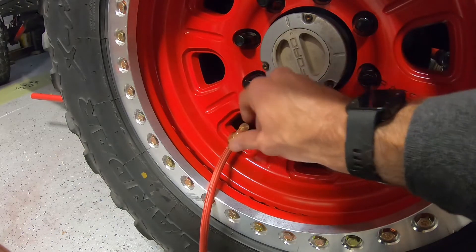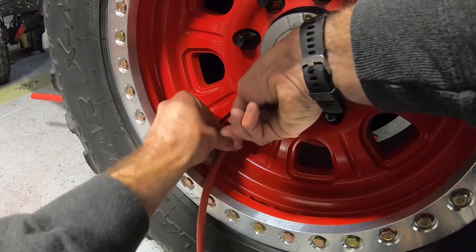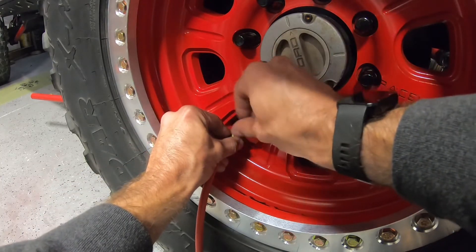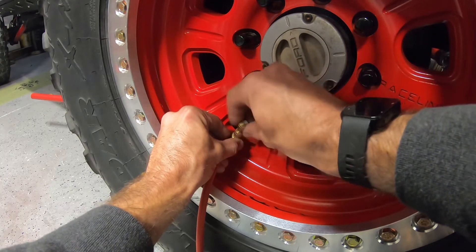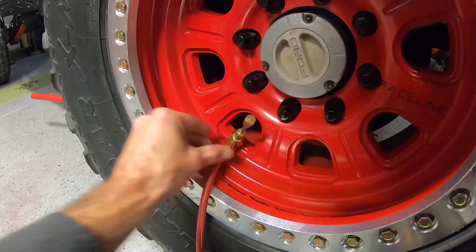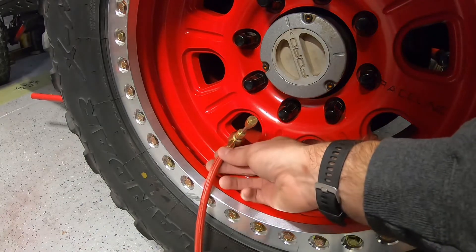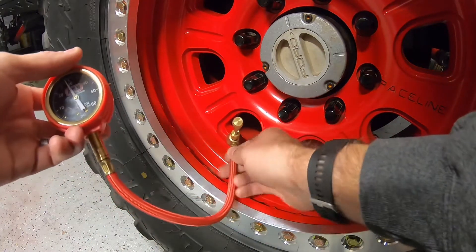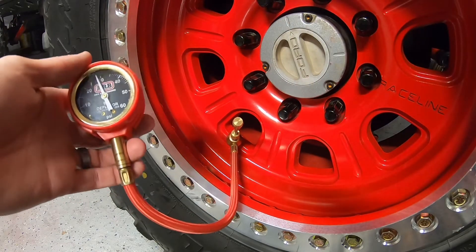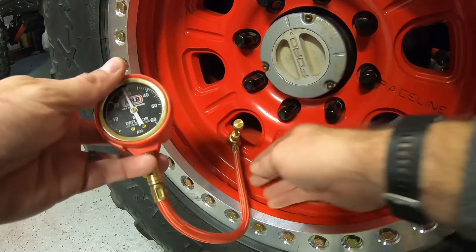You've got to kind of play with it to find the right spot. Now it's locked on — it's not turning one way or the other. What we're going to do is unscrew the valve core. You might hear a little bit of air leak out periodically; that's not a big deal. Once it's all the way out, you can pull it out. Now there's barely any air leaking. Grab the hose at the base of the tool and lift up on it — that lets air flow out of the tire. When you push it back down, it stops the airflow and gives you a reading on the gauge.